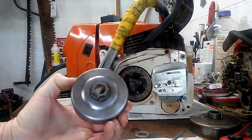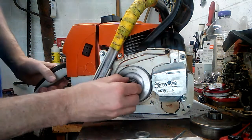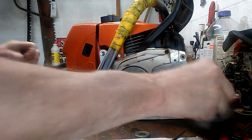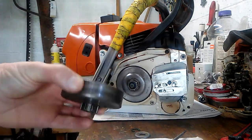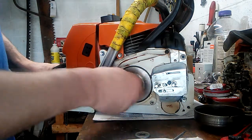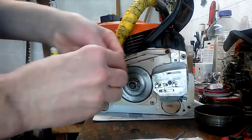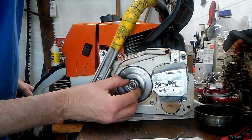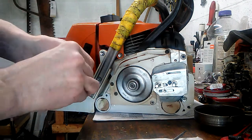So we're installing the 661 Autotune clutch drum on the Farmer Tech. The Farmer Tech unit is warped — that is the case with a lot of these components. They're out of spec, out of round, and that one is out of round. So this is a direct replacement. I didn't know this, but after doing some cross-referencing, the same drum that's on the 661 is probably the same one that's on the 660.